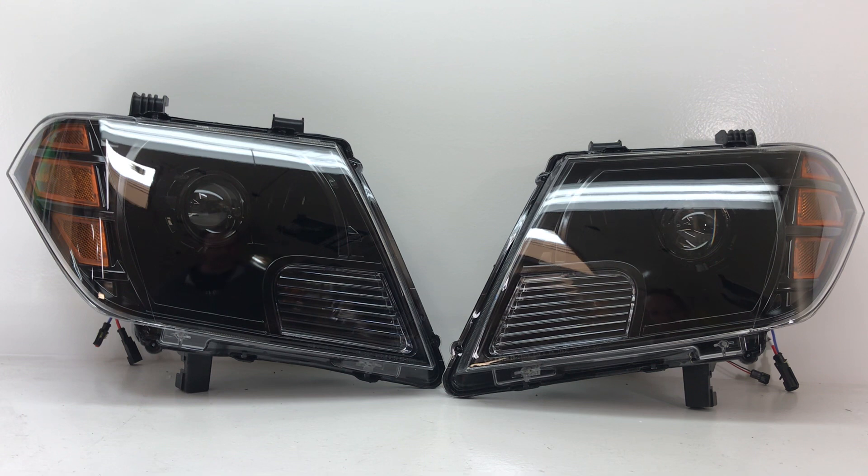So let's go through exactly what this set has. We start with a brand new set of aftermarket headlights. We paint everything gloss black — gloss black housing, gloss black bezels, gloss black shrouds — and then we install our projectors in there. You have a 6000K bulb with both low beam and high beam retained, a 35 watt ballast, and a 9007 vehicle-specific wiring harness for the Frontier.